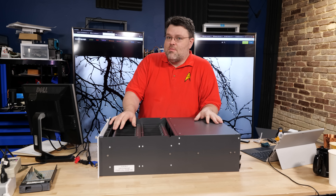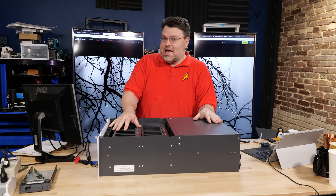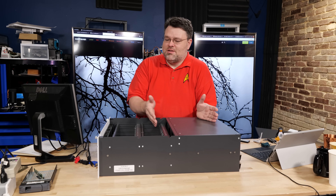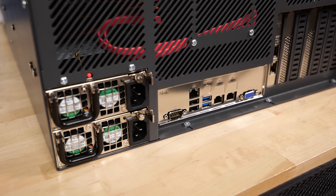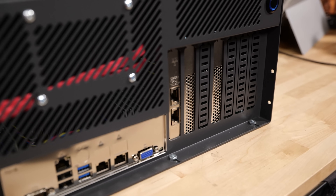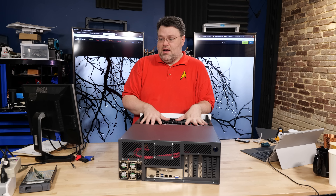When you pick up one of these, yes, it does come with a rack mount set of rails. This is the chassis, and they even have a 60-bay chassis, which is just the same except it's got another two rows of drives. In the rear, we can see dual redundant power supplies. Plus, we've also got a dual 10-gigabit NIC as well as two HBAs — host bus adapters — installed, so we can plug in our large amount of drives.